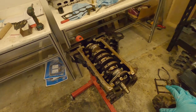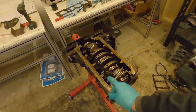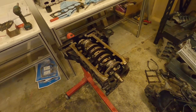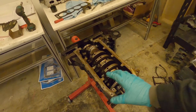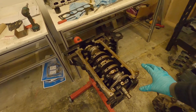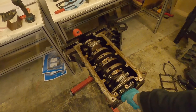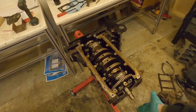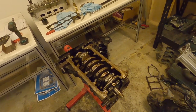The engine's been completely apart. The oil squirters are in — you've got to make sure you put your oil squirters in before the crank goes in, because it's just impossible to get to them afterwards. Make sure anything like oil squirters are in, make sure you've cleaned everything, make sure your crank's in, your rods are all in. Once you torque it up, make sure it's all still free to move — put your end bolt in and just turn the engine over. Make sure it's all smooth after torquing, make sure everything feels good.